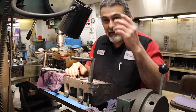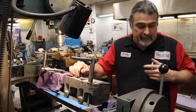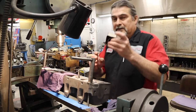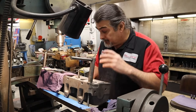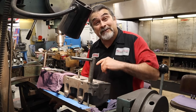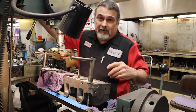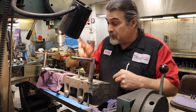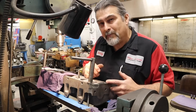Behind this camera there's a shelf of seats from SBI, from the newer to the older. You'll remember this KO line seat, SBI seat — all the older seats came in boxes like this. The size it told you on the box, that's the size of the seat. Most people did not even know what the press fit was because they would take a standard cutter off their machine — if it says a one and a half inch seat, one and a half inch cutter, cut it, drive it in, and you're done — never knowing what the press fit is.